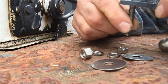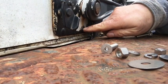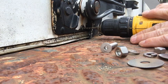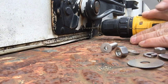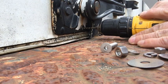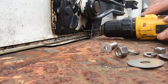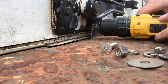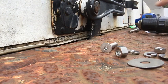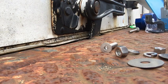This tapered bolt is going to go right in there and be flush with that surface. What I've done here is I've marked the center of this carriage bolt that's adhering this plate to the door, and I've got a very small drill bit — a 5/64 — and I'm very gently going to tap a pilot hole into the center of that bolt or rivet. That gives me a guide for a larger bit. I'm going to graduate up to a 5/32 next.